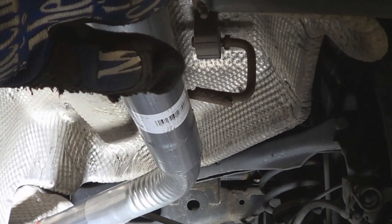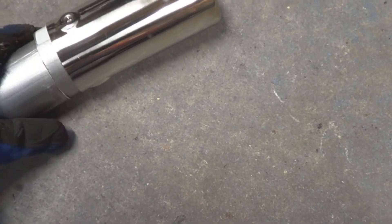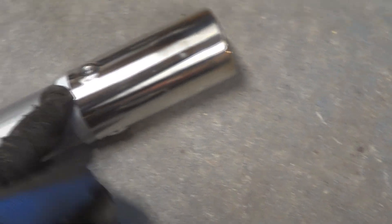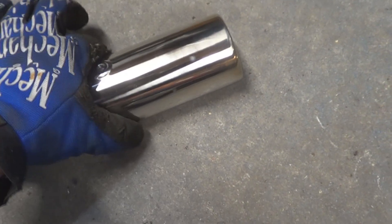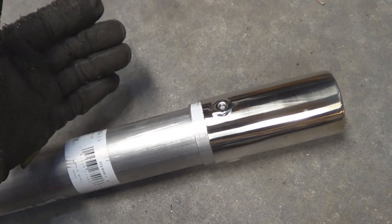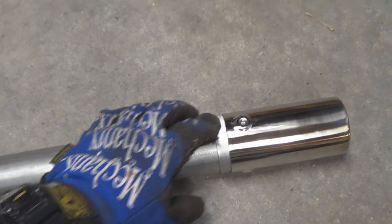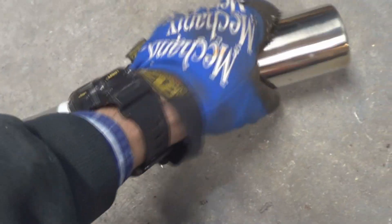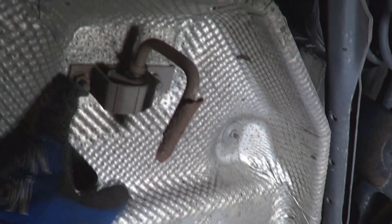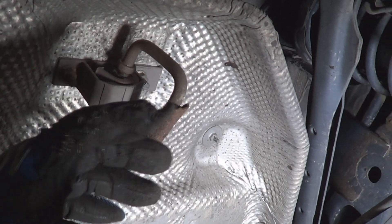I'm going to cut this piece once I align the tip. So here's what I'm doing — you can see it before I clamp everything. I'm driving this 2-inch pipe inside the tip, because that's how it's going to sit once it's all together. You won't see the pipe because I'm going to drive it all the way in and it's going to have a clamp instead of those cheesy screws. It's going to look cleaner and more professional, and that way it's not going to vibrate off. I'm going to bolt the hanger right there to hold the pipe so it's not bouncing up and down.